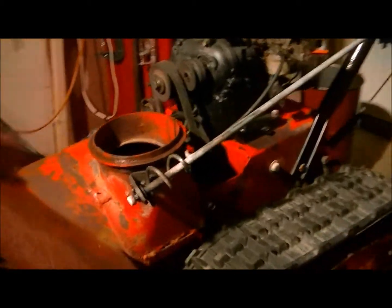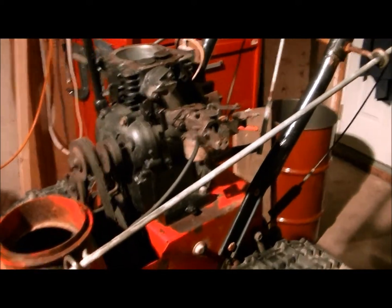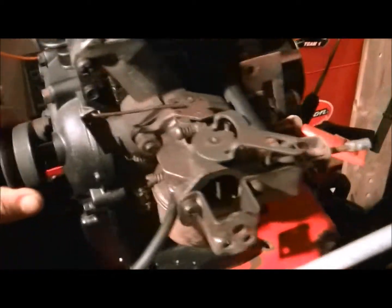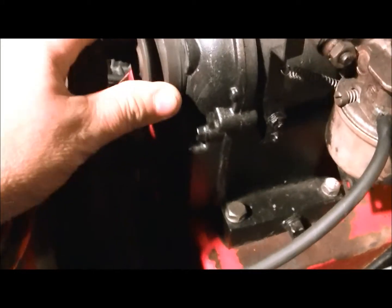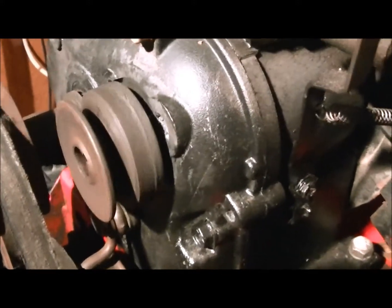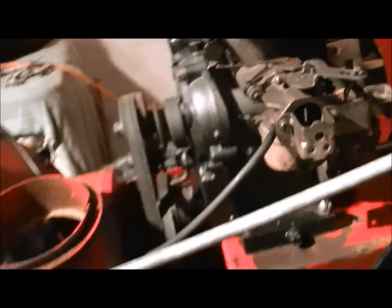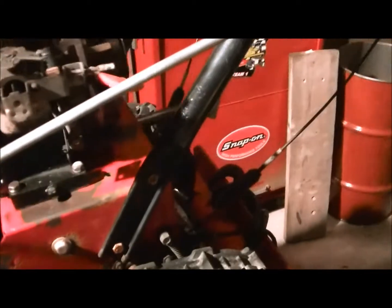Hello again, I'm just working on this snowblower here - it was a freebie so I'm just having a quick look at it. I don't think it's going to be a runner; I'm going to keep the motor. It's got very little compression, which isn't really that big of a deal, but I noticed that this little pulley here was loose. The set screw right where my finger is got loose and it's worked itself back into the casing. When I turn it over you can hear it getting past the seal that was in here. Each item on its own isn't that big of a deal but you add it all together.